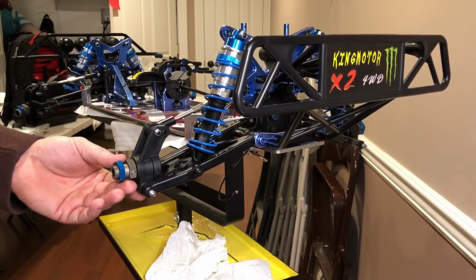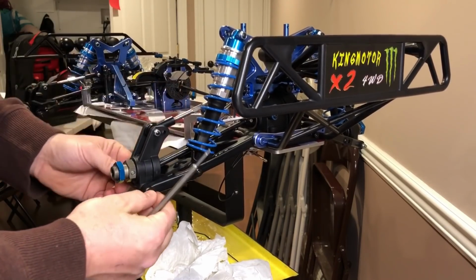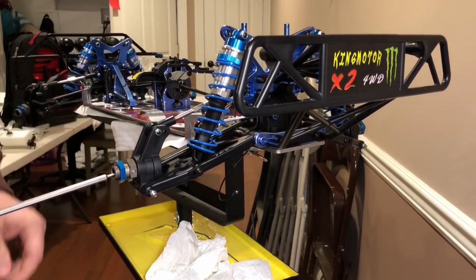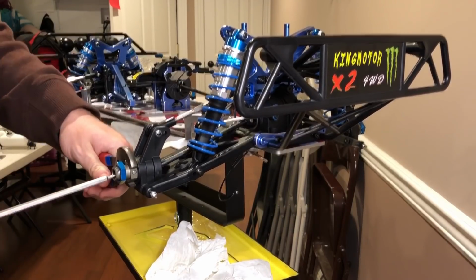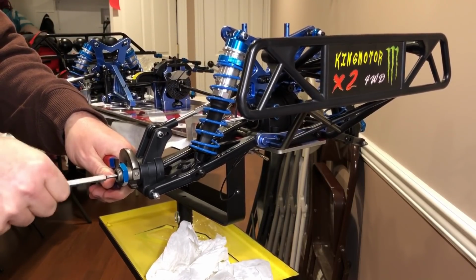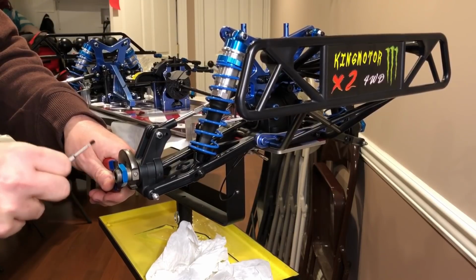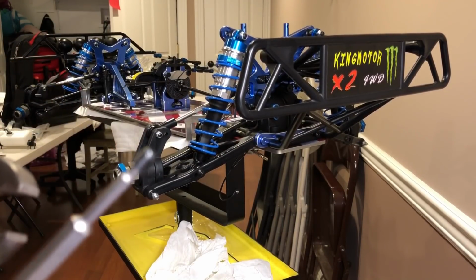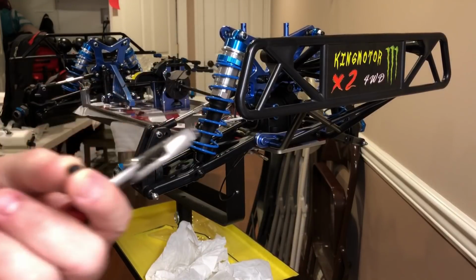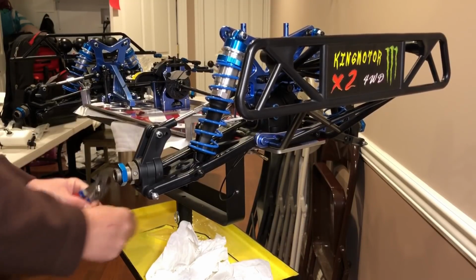The first thing I want to remove, usually on an easy job like this, a rear hub, is to keep everything intact and remove the grub screw that's in your hub. Remove that. You're going to have to hold this and break her loose. All right, pretty soft, pretty loose. Usually they're on there snug, tight or Loctited up, but this one happened to be loose. So that just shows you, when you get a brand new one like this, Loctite your grub screws. Go over everything. Get yourself a magnetic tray so you don't lose your stuff. I'm going to use a little one over here, put it in my tray.